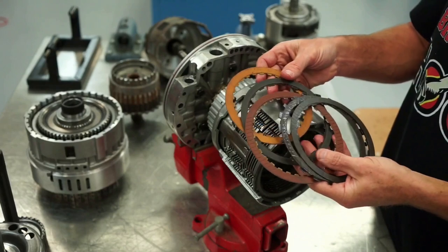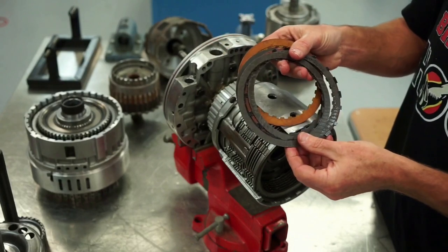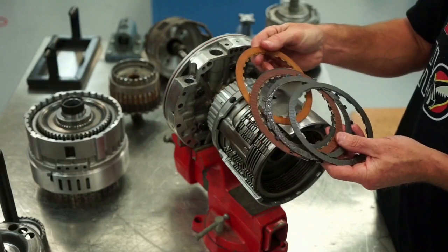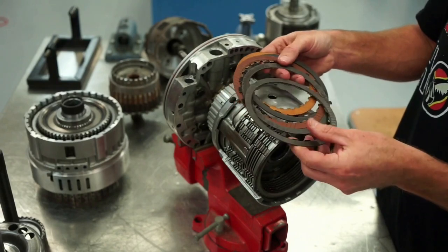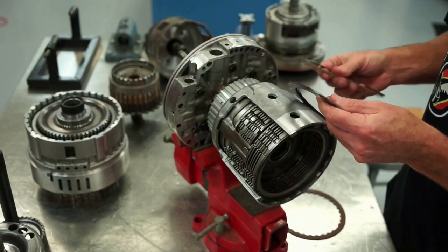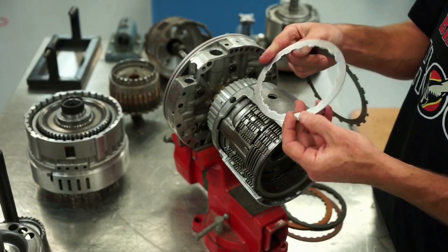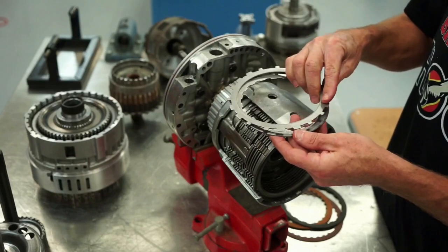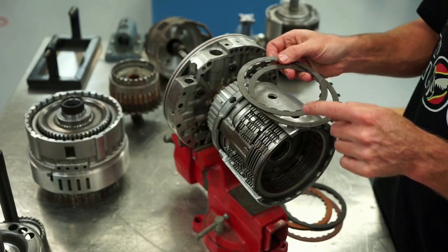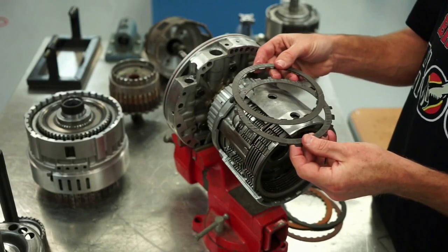When you look at these different clutches, they come in a variety of designs. Sometimes they'll be perfectly smooth; sometimes they'll have little reliefs cut out of them; sometimes they'll have grooves in them — you'll see different patterns. You'll also see them come in different colors: tan, red, or this charcoal color. A lot of times they're double-sided, meaning friction material on both sides. Sometimes they're single-sided frictions, where one friction disc has friction on one side and steel on the other, and the one running next to it has external splines with steel on one side and friction on the other — always alternating external and internal splines, with friction always touching steel.